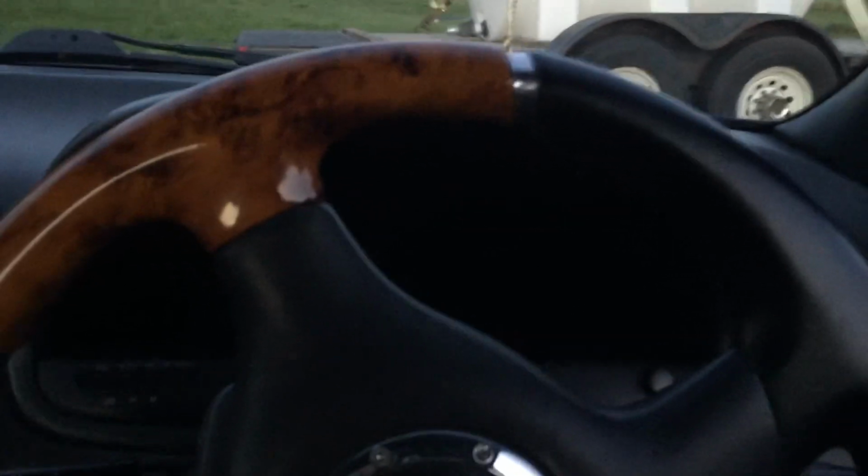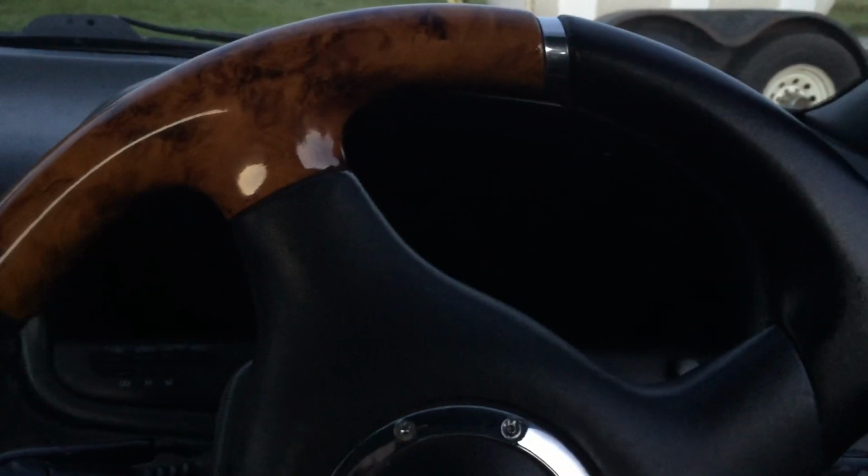It's nice to drive. Anyways, I replaced the 3 capacitors, decided to stress test it, went out and burnt some tires off and put her through her paces, and then decided to wait until a rain day because I wanted to see if it would go into limp mode again. And then basically after the rain day it worked good. I went to the car wash, washed the engine, tried to make it go into limp mode, and she wouldn't go, so I pulled the ECU out and replaced the other capacitors. It was all brand new capacitors.